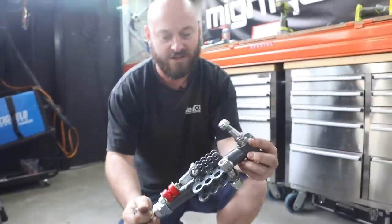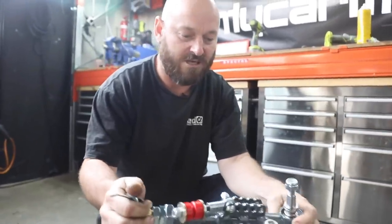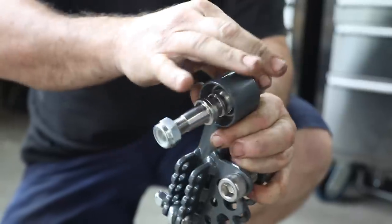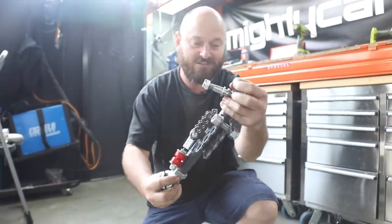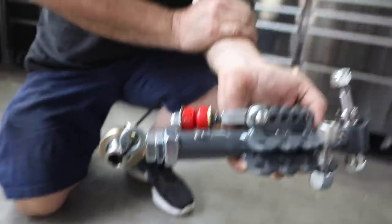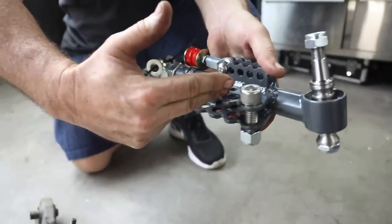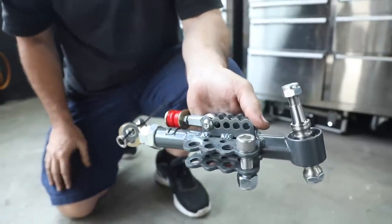If you lower the car too much, the geometry gets messed up — it needs to be on the level. What you can do with these is change where the shim packs are and push the control arm back down if you want stancy-level fitment. You can push it back down and it'll make the suspension work properly again. That's a consideration when you put really big wheels on — the wheels just don't fit inside the arch anymore, so you need to move them exactly in the middle of the arch for full steering movement.